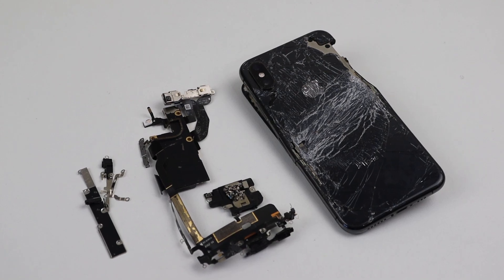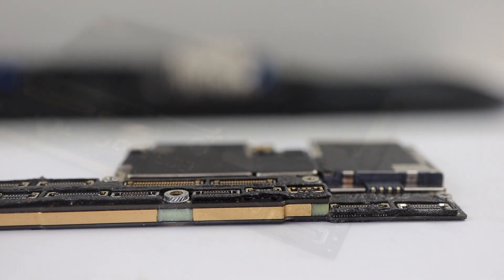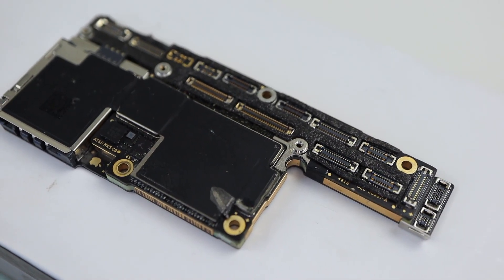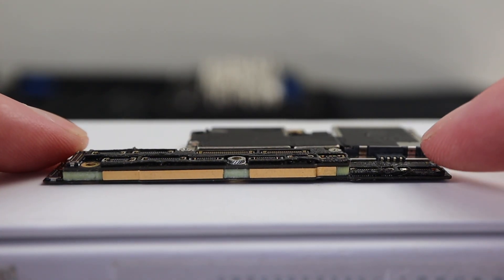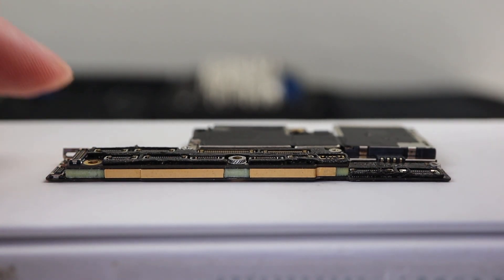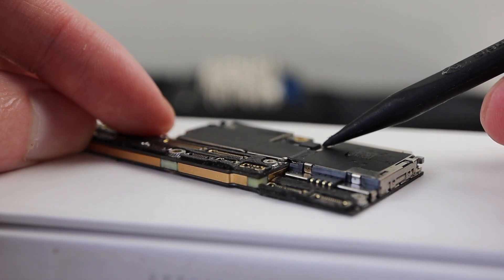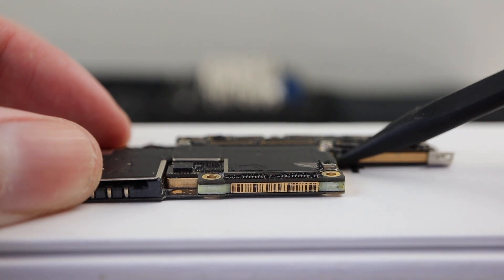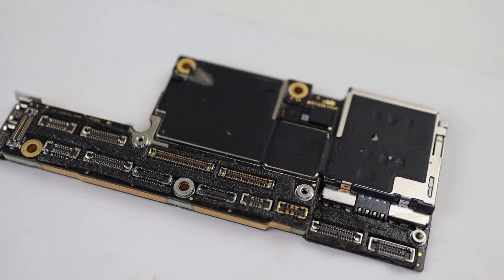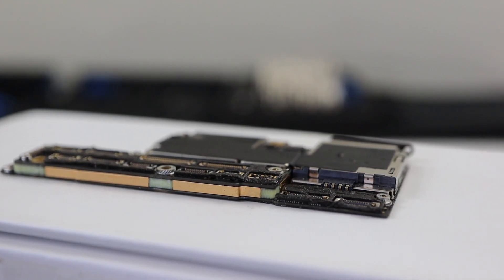These issues are board-level issues that have been affecting the iPhone X and XS phones. It's common to see phones these days with two PCBs soldered together to make a multi-layer logic board. However, issues can arise if the board gets ever so slightly bent. In the case of the destroyed iPhone, I'm not surprised to see a board issue given the extent of the damage. Both boards suffered the same issue when placed on a flat surface — it might not look like much, but it was enough to separate some part of the logic board halves and stop the phone from fully working. You can see this gold band running around the logic board — this is the spacer between the bottom and top portions. A common weak spot which causes this very issue is right next to the SIM card tray. I can't proceed any further — it can be fixed, but it's extremely complicated and out of my depth. Unfortunately, I couldn't save them, making this an unsuccessful repair.